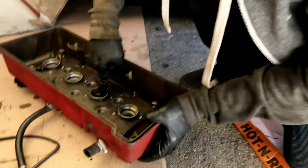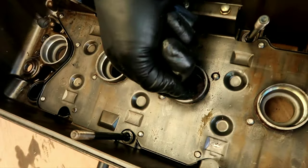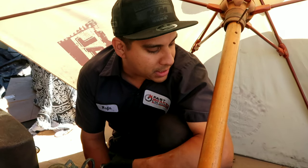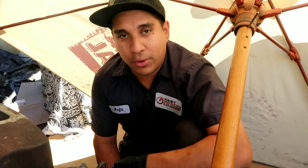Dylan over here getting down on the valve cover right now. A little bit of this meticulous cleaning here, you know? I would say the number one rule to have maximum sealing surface with gaskets, RTV, is to maintain a super clean finish on whatever you're cleaning. I guarantee you can have it as clean as you can eat off of it, it will not leak.